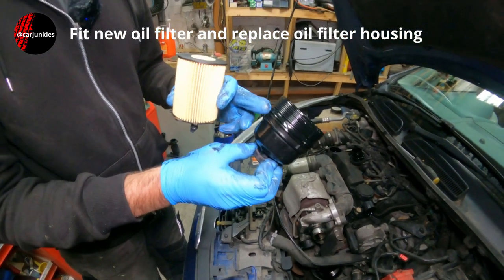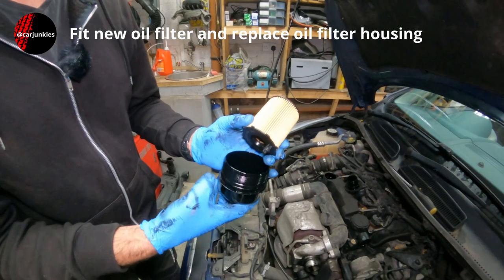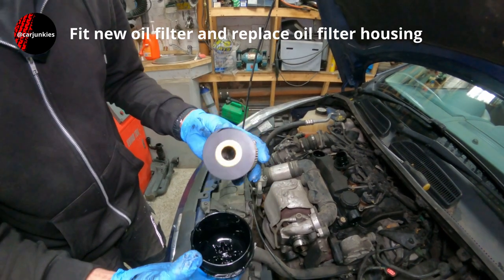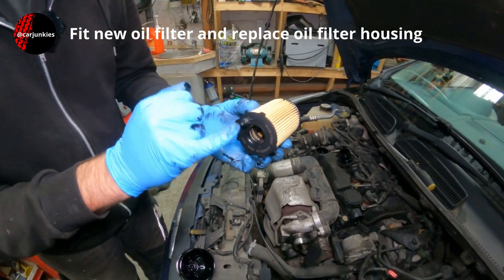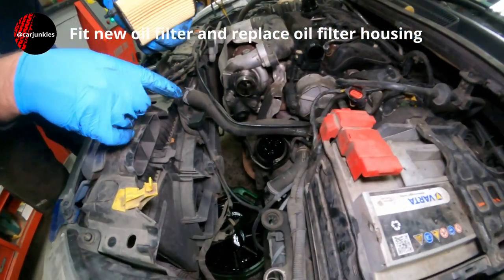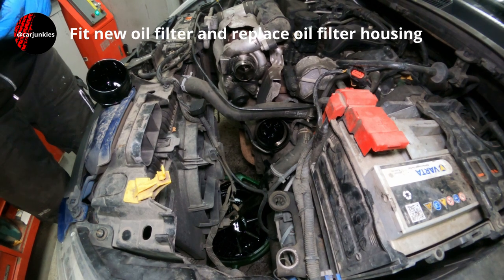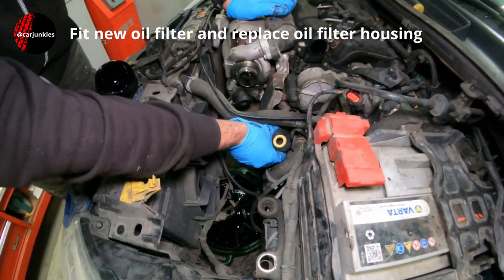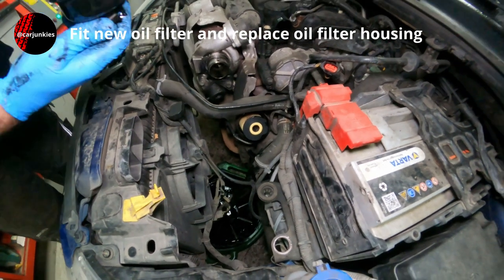As you can see there's still a bit of oil in there — tip that in the drainer and we'll get the filter back in. I've got the housing with the seal on it, correctly located in its groove and not twisted. Some people push the oil filter in here first and then screw the whole lot together — you can do that, but you're a little bit prone to damaging this lug at the bottom, which has a little o-ring seal on it. So I tend to put this into there first — at roughly the seven o'clock position there's a hole, a drilling, for it to locate into — and push that into place.